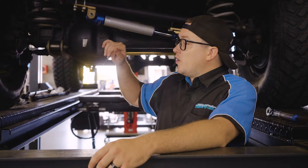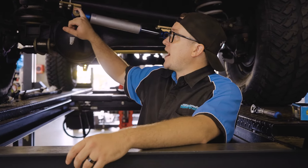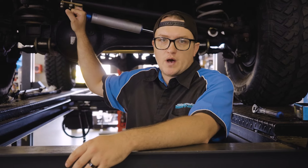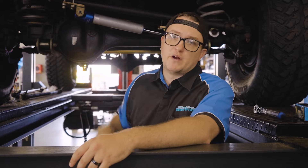So we're going to rip into getting the old stuff off. Because we're doing a new dampener bracket on this one, I'm going to start with separating the dampener from this bracket. Obviously being a taper, they can be a little bit difficult to pull out just like your tie rod ends. We'll get into undoing that one first so we can get it set up ready for the new dampener bracket.